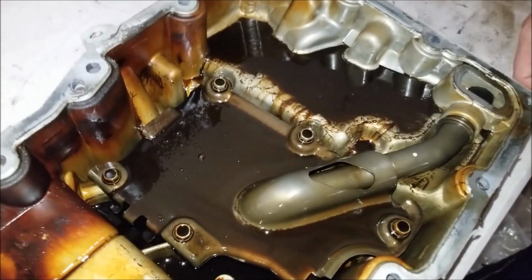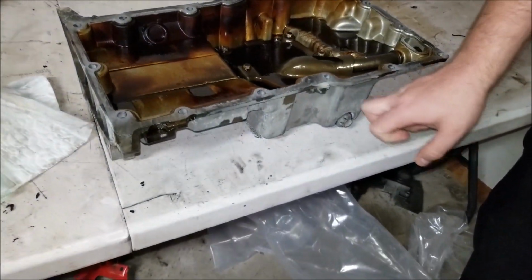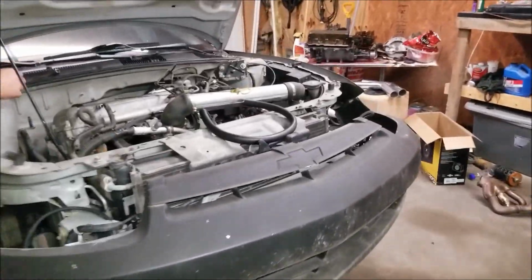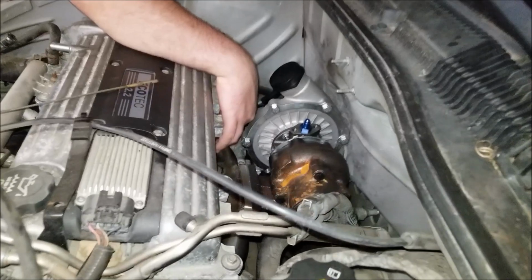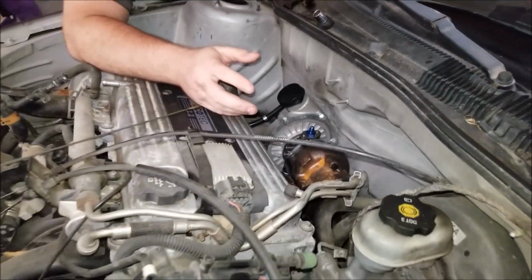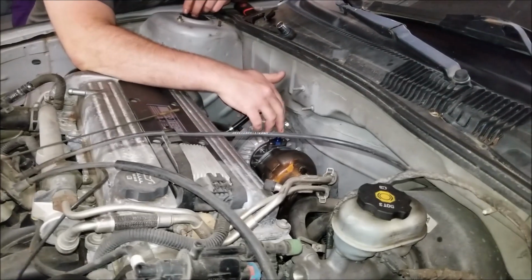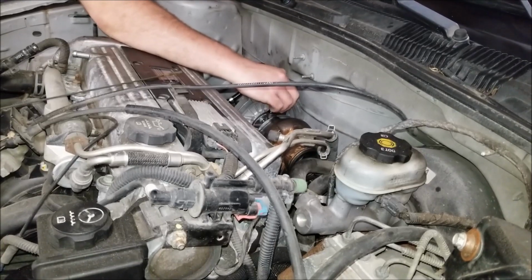Oil pan's dirty. Yeah, old oil. Set for a while. So after we get the old drain run, then we're going to work on the oil feed. Everywhere I read says that there's a little barb somewhere on the back of this motor where you can get oil pressure out of. I'm going to do a little bit more research, find it, and then we're going to run an oil line out of it into the top feed. This I do not think has a restrictor.